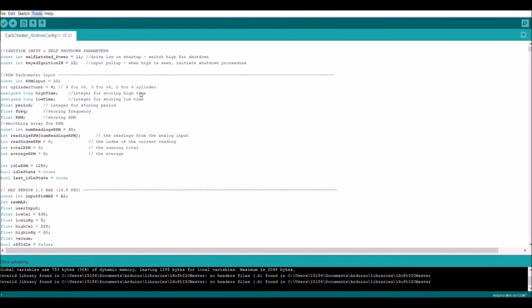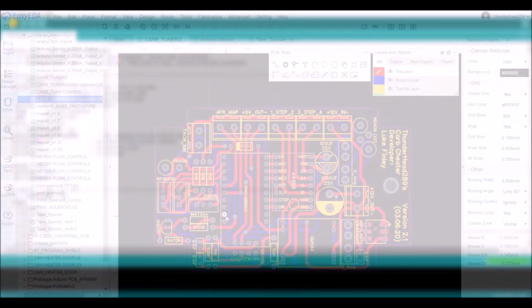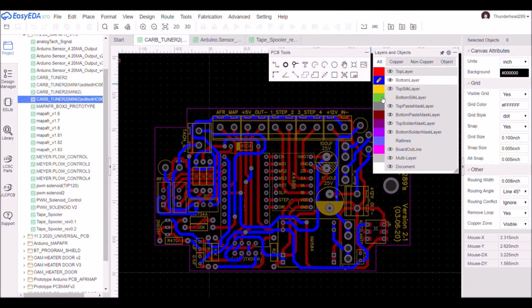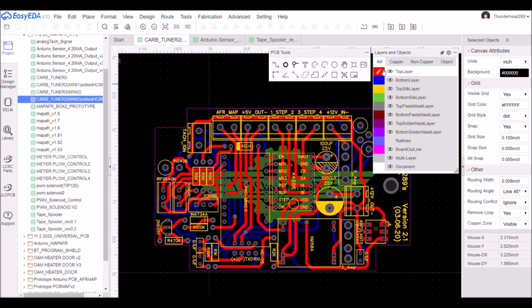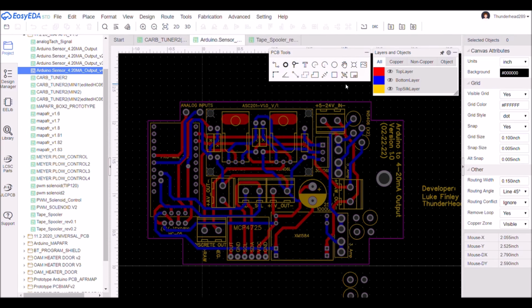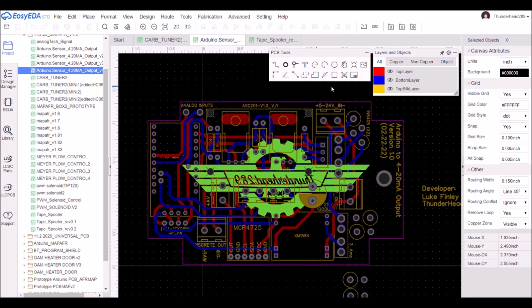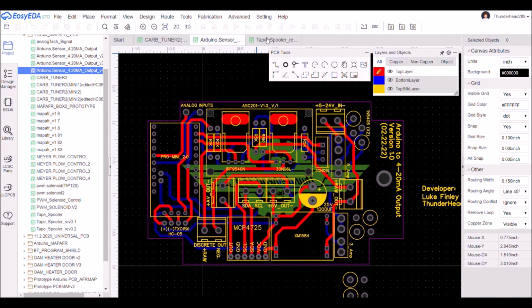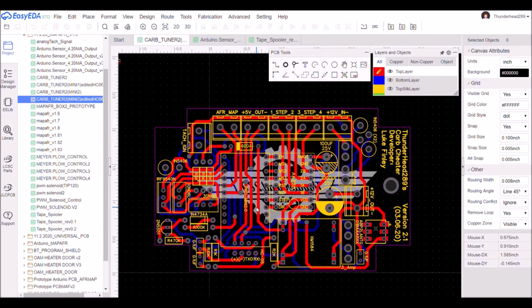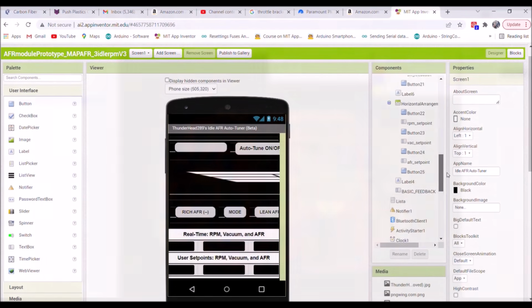Now getting back to this rich scenario that I'm assuming we're going to have when we're trying to go down the road, remember this carburetor doesn't have all the dynamic circuits that a normal automotive carburetor would have to handle the dynamic load scenarios. So I basically designed and programmed a little carb cheater that has a valve that I can programmatically control to add or pull air. So I can essentially on demand adjust the air fuel ratio by allowing in more air or less air. I made this all on open source software.